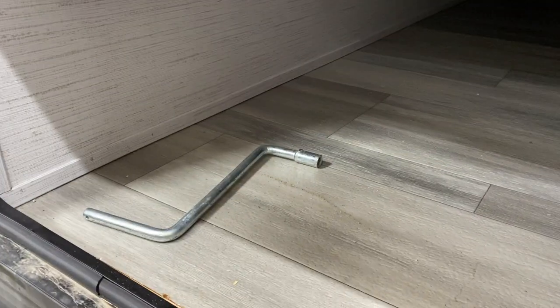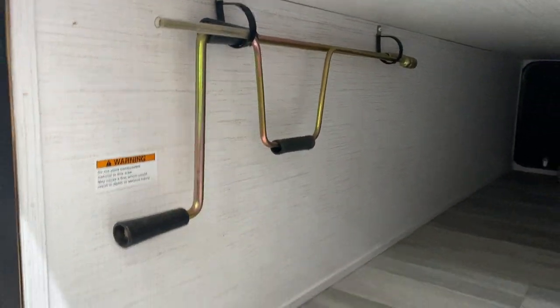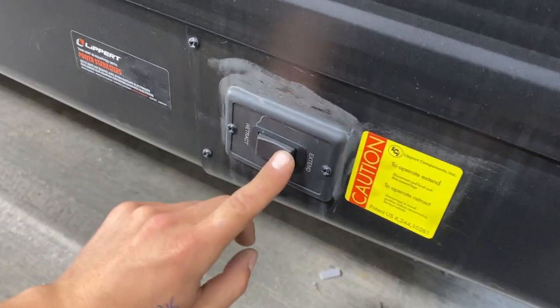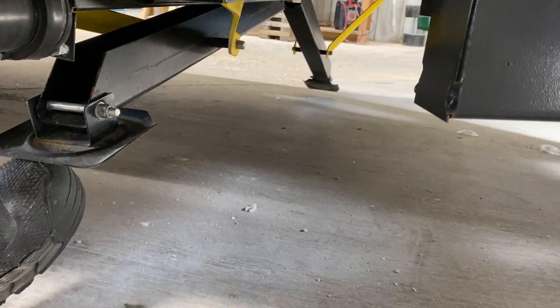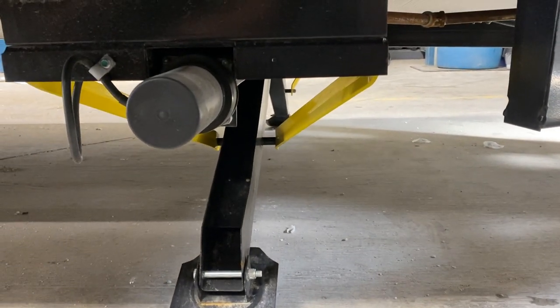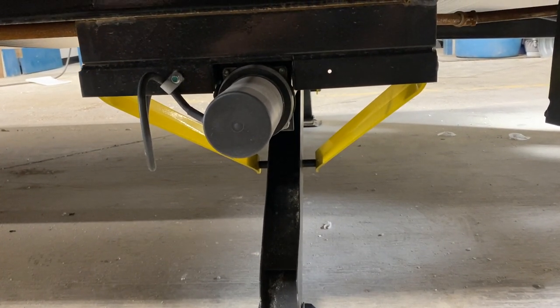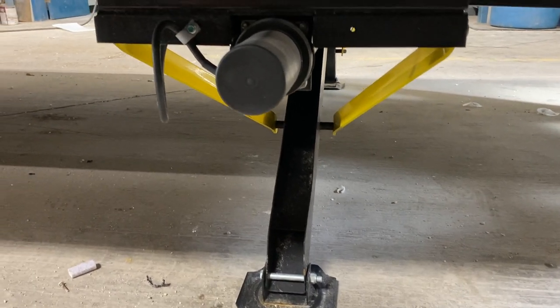The other end of your storage compartment is here. Inside you'll see the manual jack for running the front stabilizer, and the one up top is for your slide-out as well as your stabilizer jacks. The stabilizer jacks are electric — press and hold extend and the stabilizer makes its way down. Keep in mind it equalizes rather than levels the unit; it just stabilizes it. Once it contacts the ground you'll hear the load on the motor — once you hear that, stop. If you continue extending you can strip the gear set right out of those motors, rendering them useless.